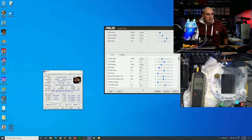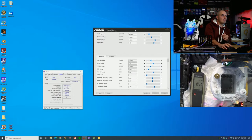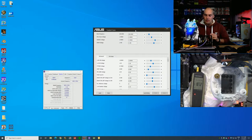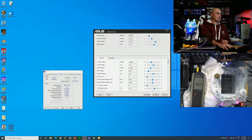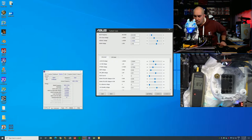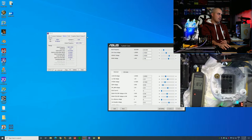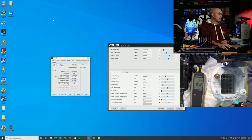Maybe it was just a training issue. So we are full pot, 1600 megahertz, which is okay. It's an honest chip. Let's see if we go down a bit. Oh, nice. Now you should see the temperature going a bit down if I go down with the SoC, or if I crash. This is weird. Maybe I just need more SoC to boot and I can bring it down later. Let me try a benchmark first.